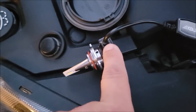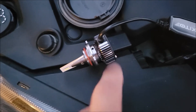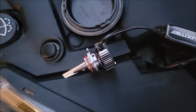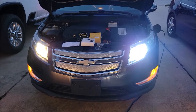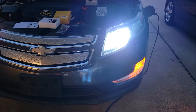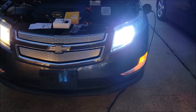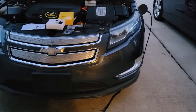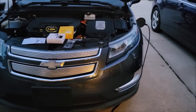That helps me understand I need to move the wire the opposite direction — counterclockwise, probably to 10 o'clock — and then tighten it down, so when I get it in and turn it, the beam will be straight up and down. That calculation was pretty much spot on; the beam in that light is straight up and down. It's hard to tell on camera because it's so bright, but there will be a slightly darker spot in the middle and brightness on both sides — like a cat's eye where the light beams evenly on both sides.